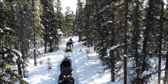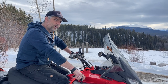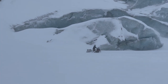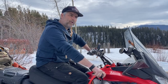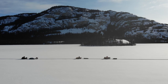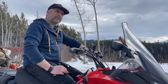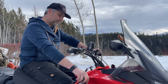There is low range and high range. I'm mostly crawling on low range — whatever I do, whether it's firewood, exploring a new trail, cutting a trail through the forest, or pulling heavy loads on the lake, I'm mostly using the low range. Sometimes we do rides with no loads and we want to go wide open on the lake, then I use high range, but it's pretty rare. The high range is quite high. A few times I've used high range and forgot to put it back to low on the trail — you really feel something's wrong. Unlike the wide track I had before, there's a big difference between high and low.